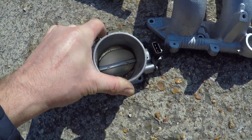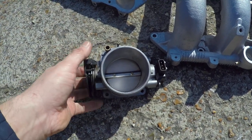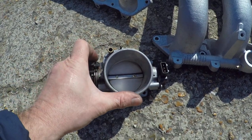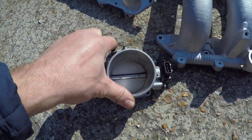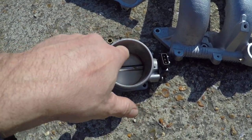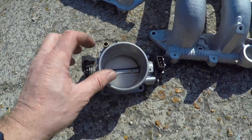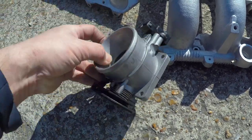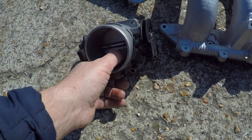What that does is dull off that initial feeling, which also doesn't help the ABF, which feels quite flat in standard form in terms of throttle response. So normally we would literally take this all off to make it quite a bit more aggressive, but I think what we'll do is take maybe just a little bit off this. It's got a little sharp ridge on there, so we'll take off a bit of the hump and a bit of the ridge.